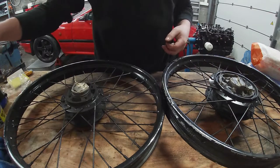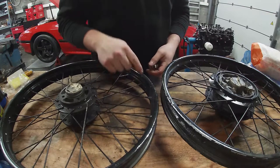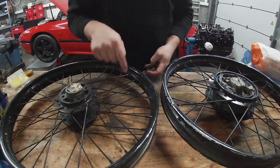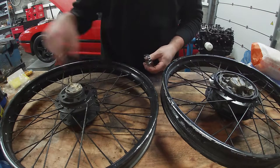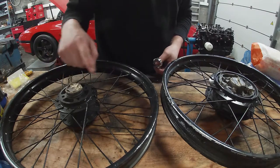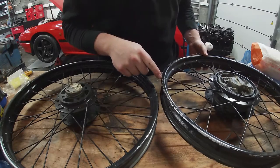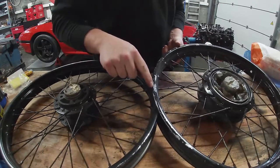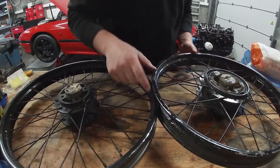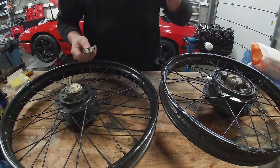Sadly enough these wheels have been painted black. I'm going to disassemble them because I'm going to try and bring the chrome back. I'll disassemble them, measure the spokes, and order new spokes, then try to remove this old paint. Hopefully this will come out all right. Looking here, some of these spots are actually not too bad, so I hope these rims are saveable. Let's start by removing the spokes.